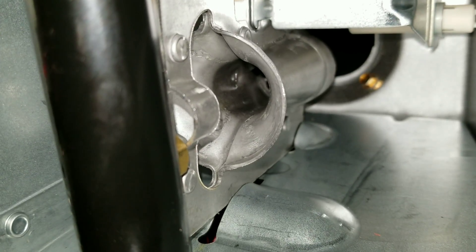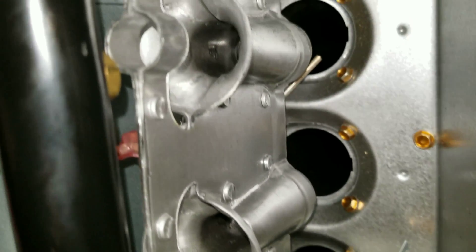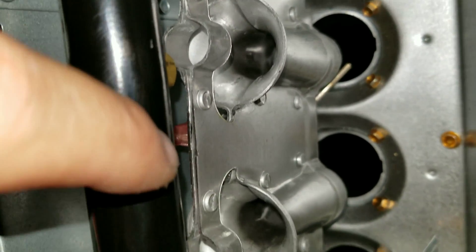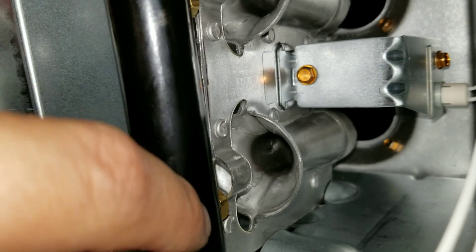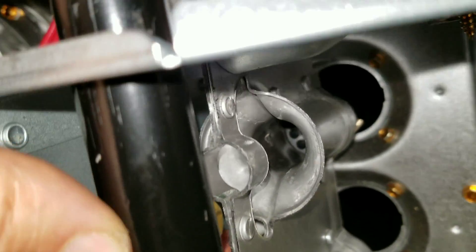Get the camera in there so you can see — you can see our orifice compared to our burners. All the way up you can also see the burners, and the gap right here between the manifold and the burners is way off. What's happened is they've put these burners in crooked.